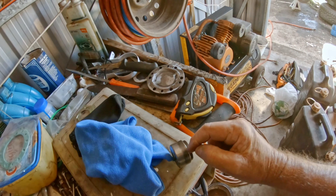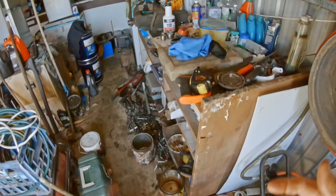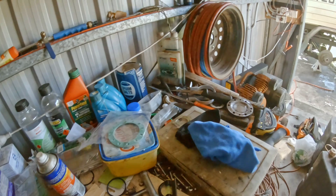What I do is grind that edge off along the outer rim - just a couple of thou, about the first three or four millimetres. I grind that down and that stops the crud building up and seizing them - you get a lot longer life out of them. New pistons are $30-40 each but the same thing will still happen - I get three or four years out of the rebuilt ones and just rebuild them again.